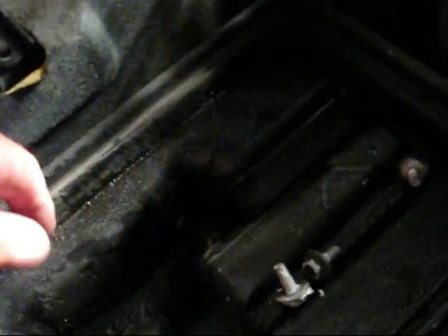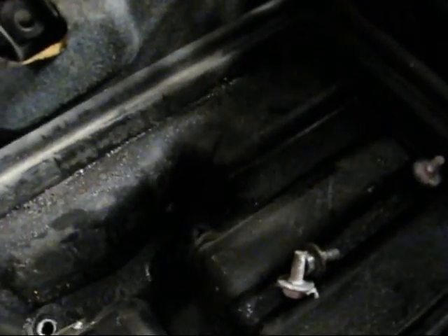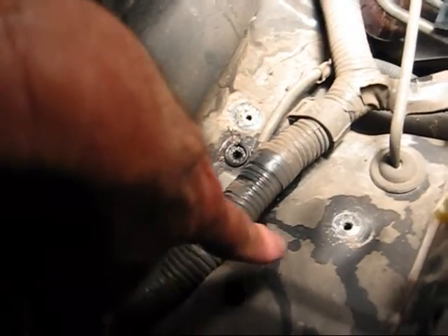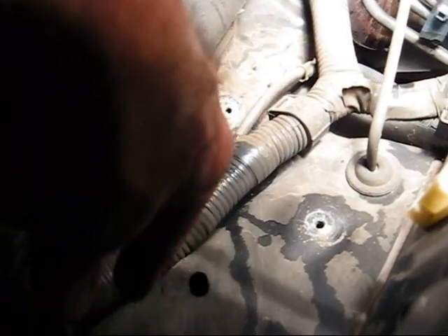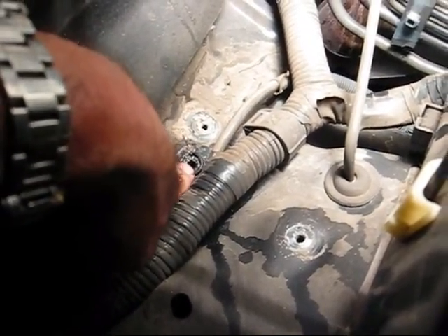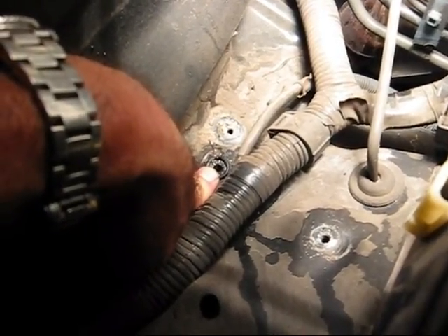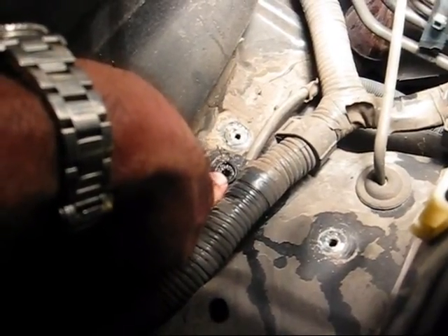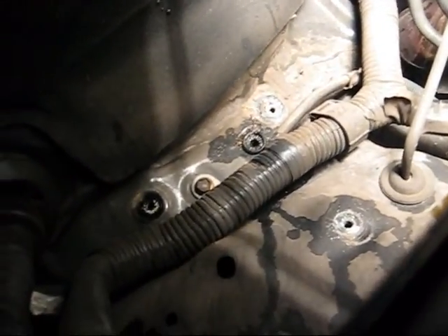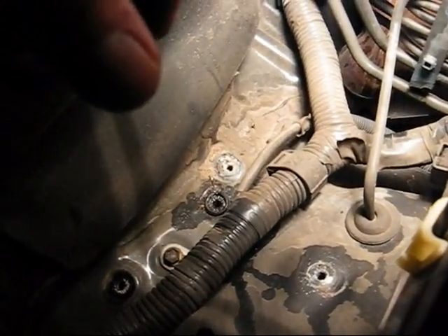I got lucky — I loosened up those three 10-millimeter hold-down bolts and I'm going to be able to get this tray out. I don't see any damage underneath here. There's a little bit of traces of where the acid dripped, and I'm going to neutralize that with baking soda and water. This looks like the drain hole — the drain from the bottom of the tray went down here. I think Lexus was smart enough to make this drain go straight down to the ground. I'm going to spray this up and clean it, clean the tray, and then put my new battery in.